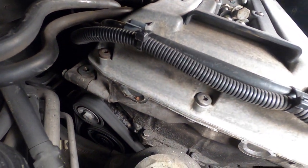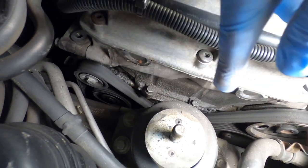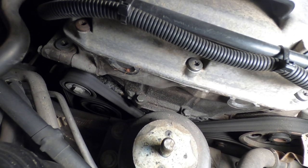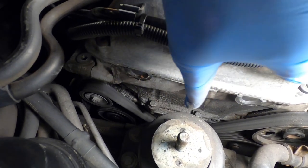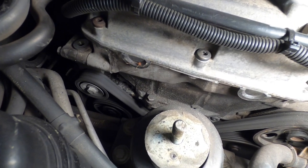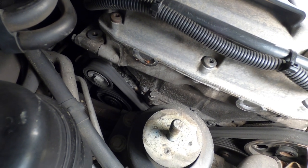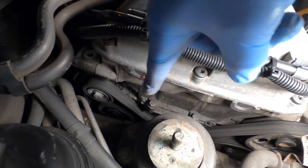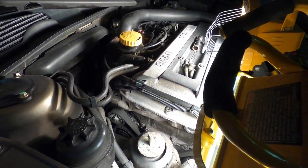So here it is — it looks like they never changed or removed the pulley. This is still the long belt. So we're going to go ahead and bypass that center pulley there. That's pretty interesting. I bought the short belt. You can see all this oil over here — that's all fairly old oil from very old leaks, nothing that seems current; it's pretty dried up. So that's a good thing. We'll remove this belt, and again, I have the short belt, so we're going to be avoiding that center pulley. Those pulleys tend to go bad and you don't need them.